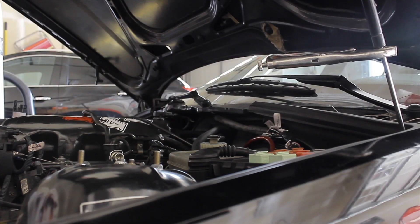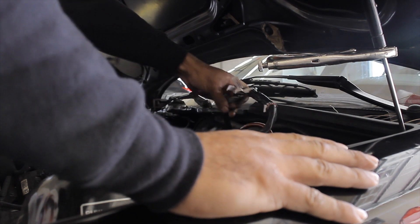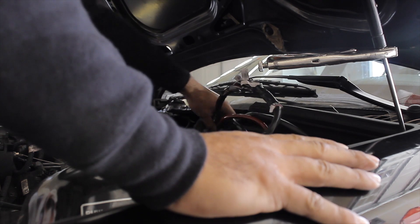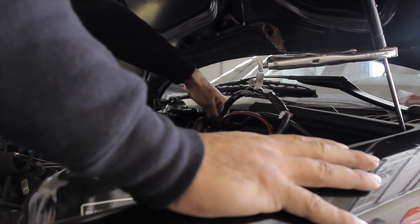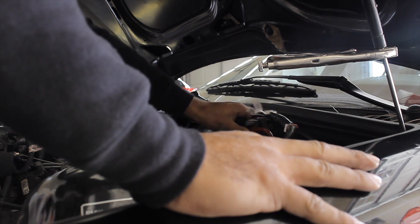If I get it like that I'll be more than satisfied. Most of the engine harness on the BMW is not needed for the LS swap, so I literally kept a lot of it just in case but I don't really need it. If you guys can see this big old harness, a lot of it is not needed. So this big guy I'm gonna strip down and then make it a lot cleaner — run them all together.